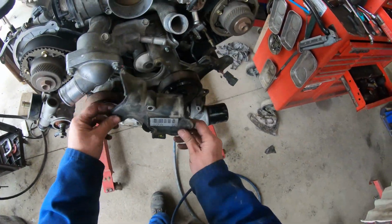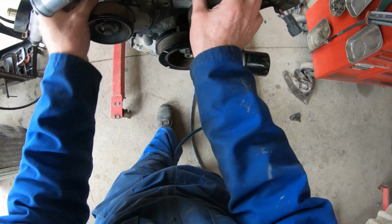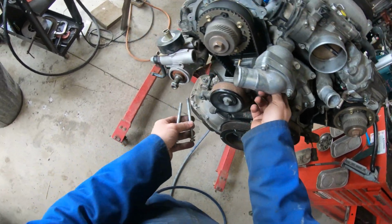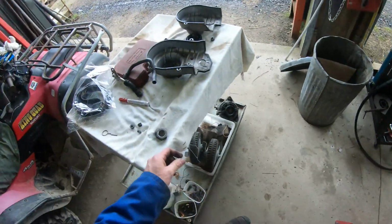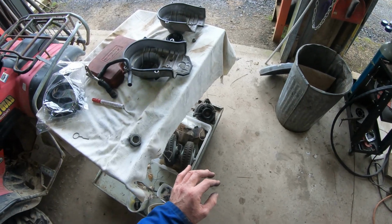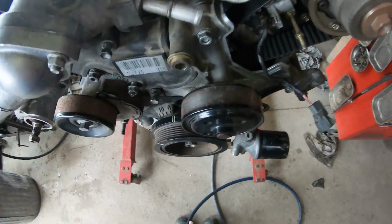This cover. Now, clip here and a clip here. I could hear it go positively clicking in. Long bolt there, and all these bolts are the same length. There, over here, down here. Nope, it's the top one. 3 nuts. Here, here and here, and the one hanging off the rattle gun. 14mm headed there and there. Well, let's rattle those 12s up.